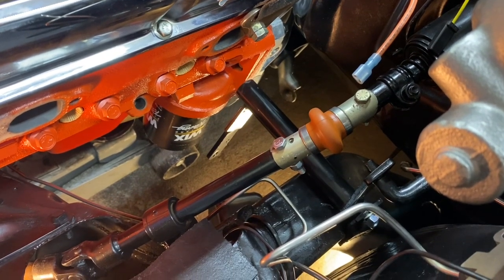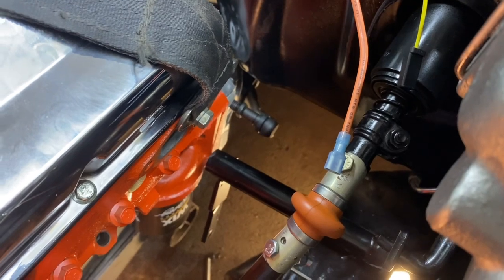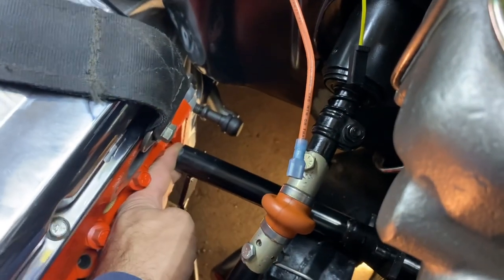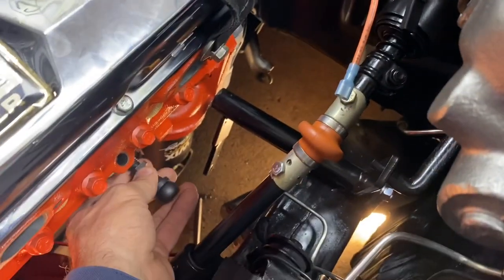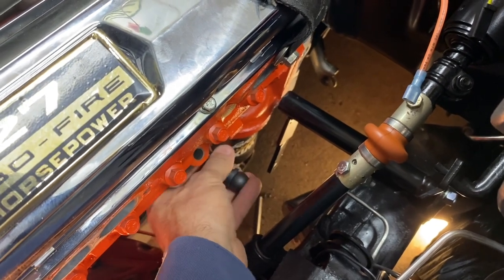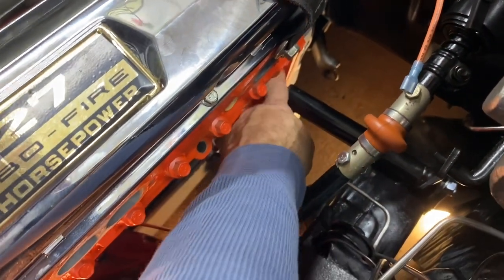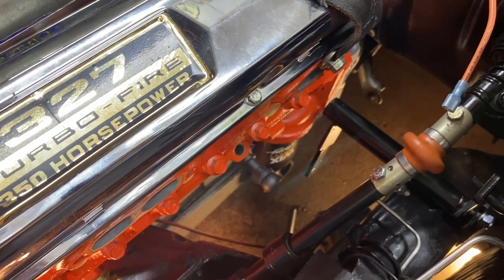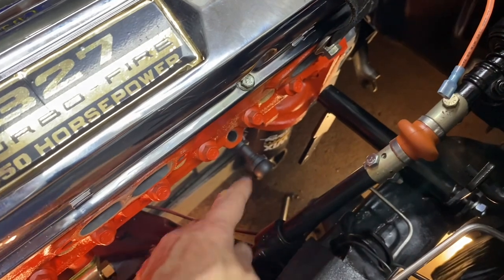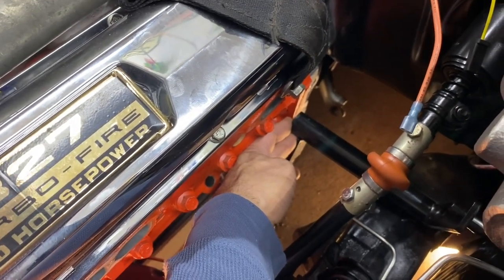After fighting with the linkage to get the pivot stud to fit inside the z-bar, we have it laid in the car - and we have another problem. There's a place for the ball stud on the bell housing, but that is way too far backwards. We need one further forward and there is none there. I ran the block number - this is a Corvette block from 1962, so they would have used the stud in a different application. They never put a boss on the block there, so now this engine is built and what are we going to do?